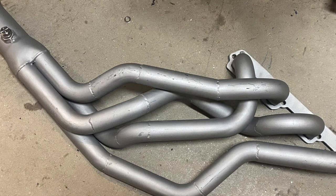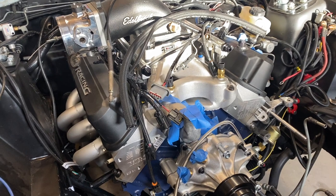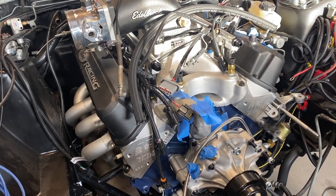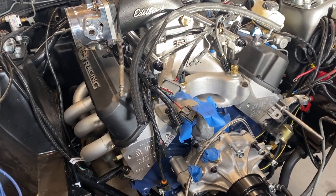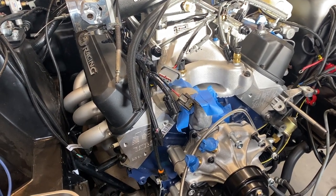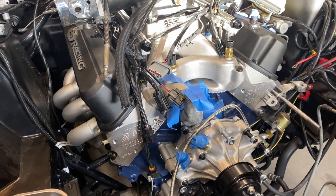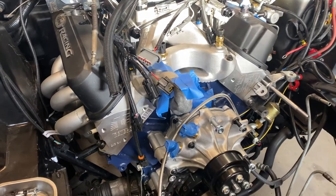The challenge for me is I'm using an AOD transmission, and if you're using an AOD this makes all the difference in the world when choosing your headers — it can be an absolute nightmare, and it was for me. I had so much of a headache that if I were to do this all over again I would probably just spend the money and get custom headers. That's your last option. Maybe not so much for a manual transmission, but for an AOD I would strongly consider it.